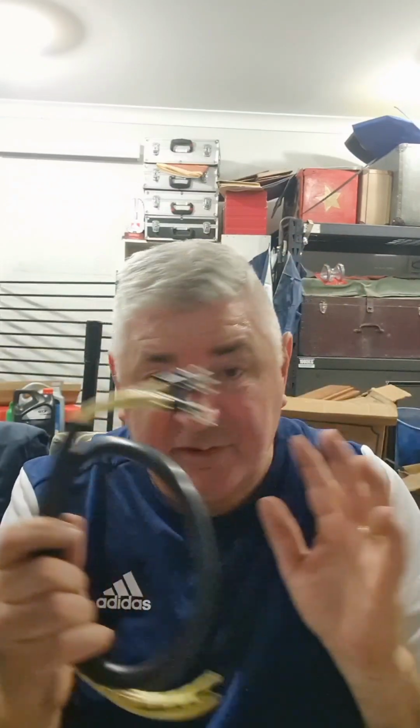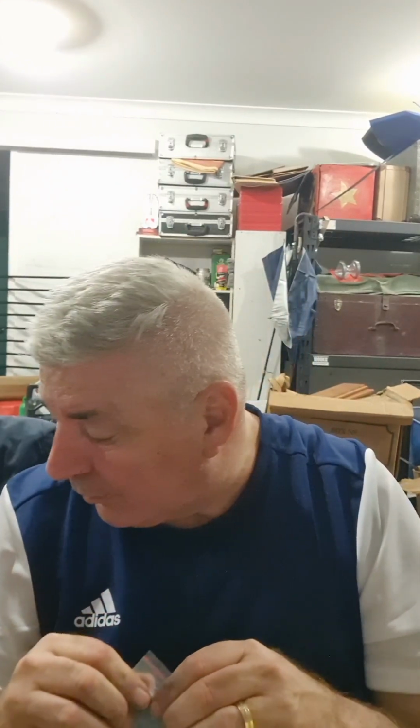So the pigtail goes from either side of the radiator. There is a driver's side and a passenger side, and they go from the radiator support panel, connector block either side, through to each of the headlights. So as a consequence, that is the electrical system on a 48 model or an FJ, and every single one of them's got them. Now that's the standard. Obviously, if you want to get fancy and have all sorts of customized wiring and whatever, sure. However, this is the standard that I can talk to.